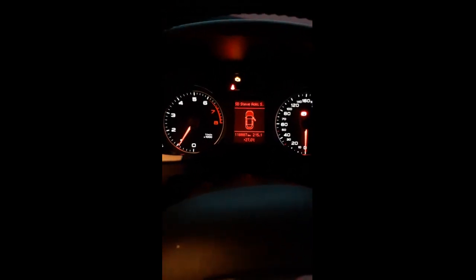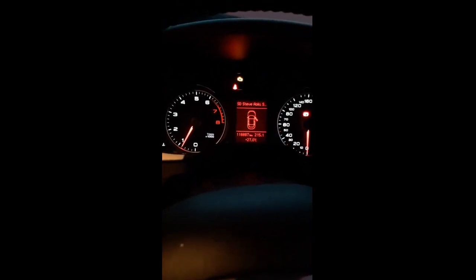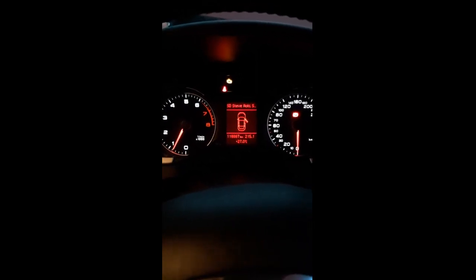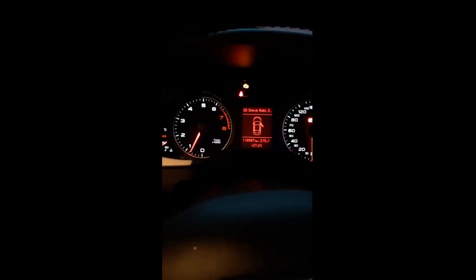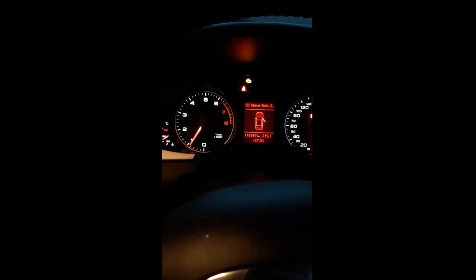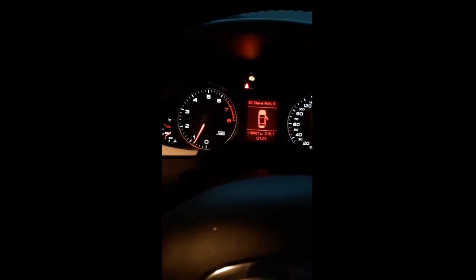There was an obvious engine fault there. The car was running lean or misfiring on cylinder 1, but that's related to the PCV valve. So now there's no noticeable shudder on the revs or on the engine that I can feel. Very, very smooth. Let's go have a listen outside.